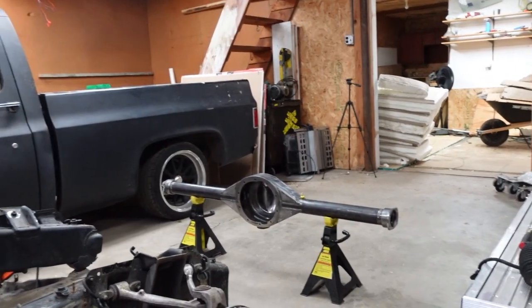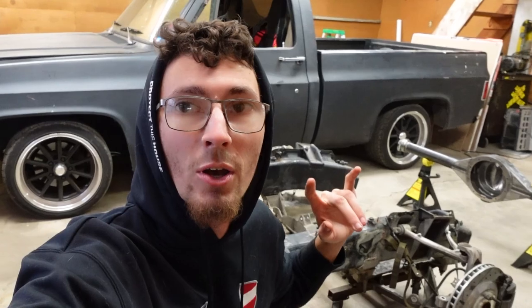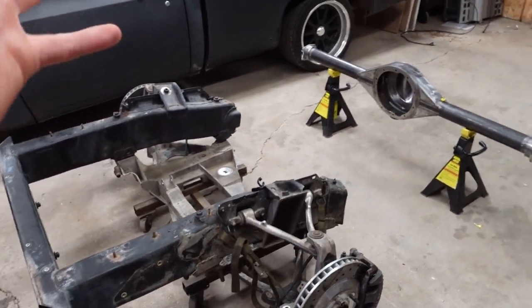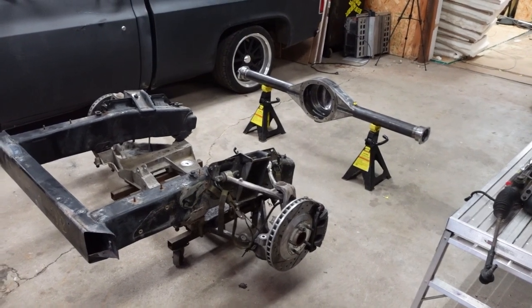The original plan was to take a nine inch, put it in the back of the truck with a four link — but then the C5 front stub came along. With it, I can lower the front of the truck and keep the nice geometry of the Corvette. But if I do that, I have to notch the rear. The frame's kind of a noodle, so I should probably box it. Boxing the frame is a lot of work, so maybe I'll back-half the truck... I guess I should just build a full custom chassis. Yes — I'm going to build a full custom chassis from scratch with a C5 front stub and a nine inch rear end.